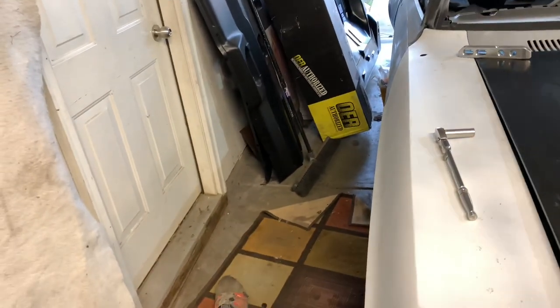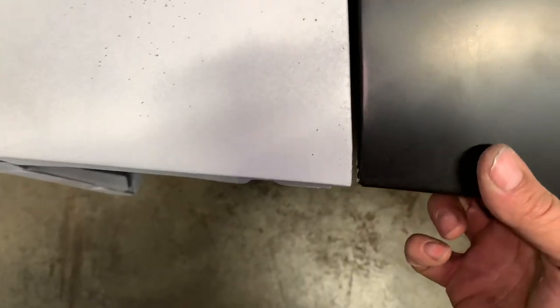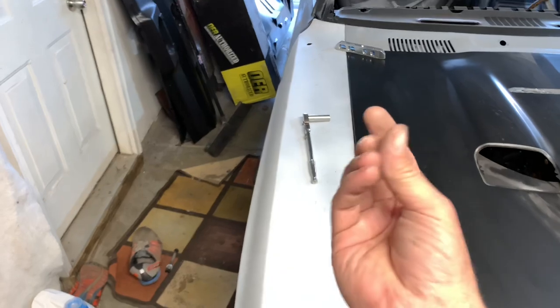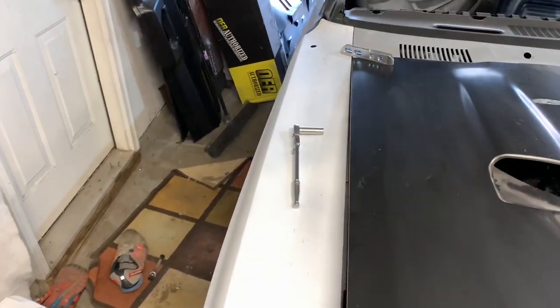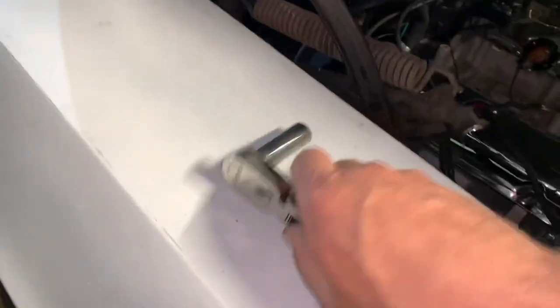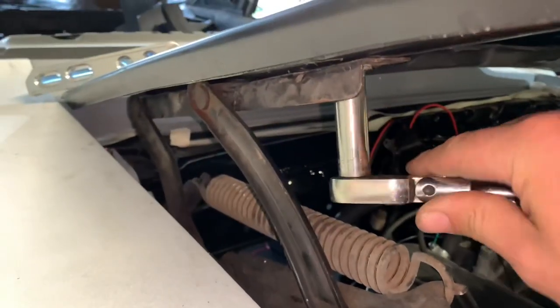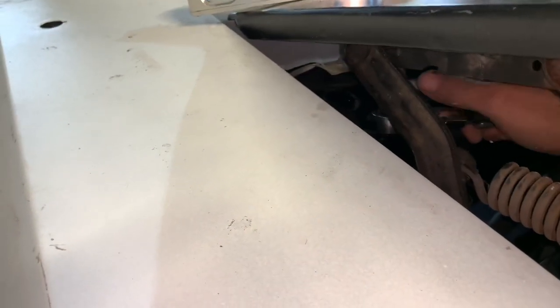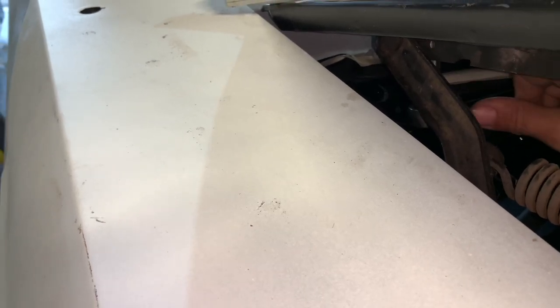Take those loose. If I give this hood a little tug — went a little too far there, don't know my own strength, but that's okay. Just bump it back into place a little more. That's pretty good. This is a repop hood, so the trick is you just pick the hood up just enough to sneak your hand and ratchet in there and snug those bolts up. If I were to open it all the way it's going to slide and mess everything up — just enough to sneak my hand in. The back one's a little trickier.